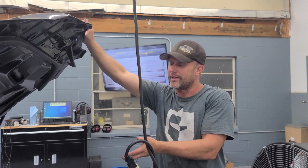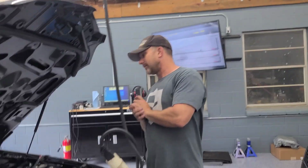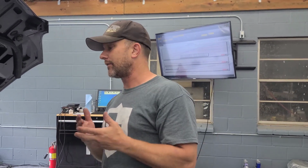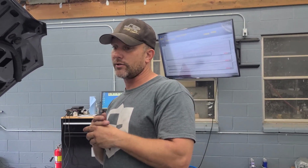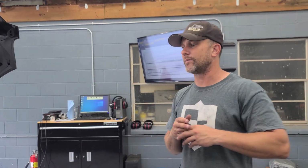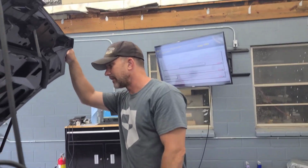What you need. More than adequate, right? Okay, that's a good point. I never even thought about that. The sensors actually flow pretty good, even though it's like a 5/16 hose. They also make one now, Racetronics. We used to get them on eBay when they were pretty good quality, but they're bypasses where it'll flow half through the sensor and half around it, so you get your full flow. But you really don't need that until you get way up in the flow. Just something to think about.